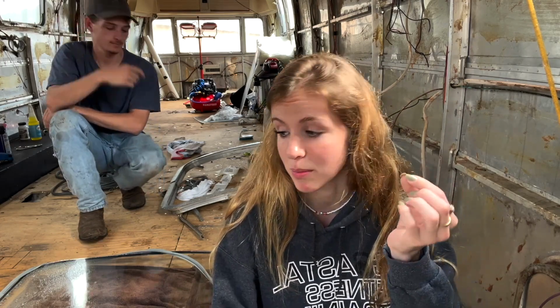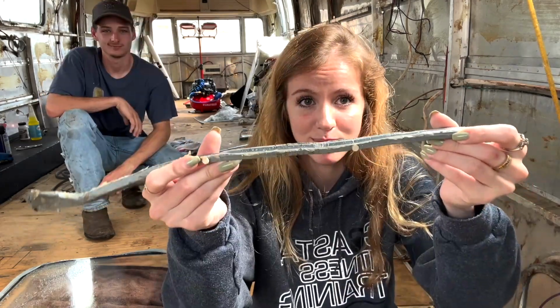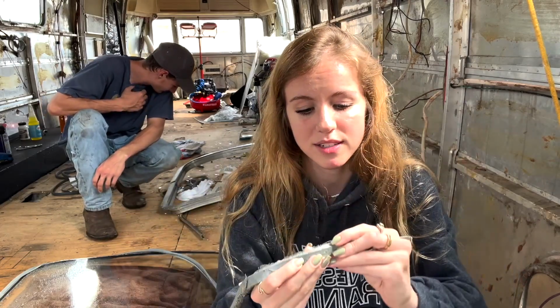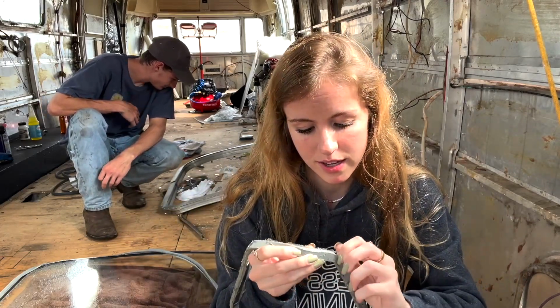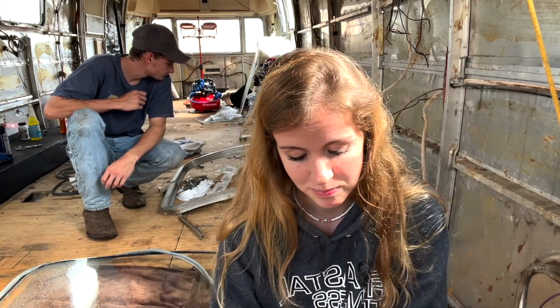I don't know. But we looked into that. We came back out here, we measured the thickness of the butyl tape and the little plastic spacer bead things. Do you have one to show? It's significantly thicker than 3/16, and it has these little plastic pegs in it that have a diameter that measures 1/4 inch.